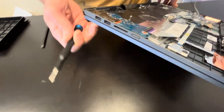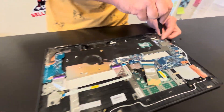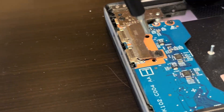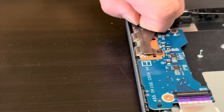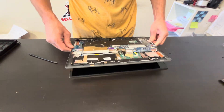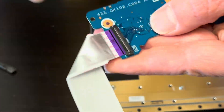That's our I/O board with the USB ports and the power button. In order to take it out, we have to unscrew the hinge screws — let's do both hinges, because the other one covers the motherboard. To pull out the motherboard we'll have to unscrew that hinge as well. Disconnect it from the motherboard, then gently unfold the hinge assembly. That's our I/O board with the card reader, power button, and USB ports — if one of these doesn't work, you can replace this board. Here is the part number.